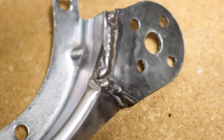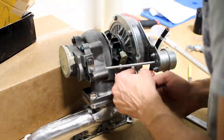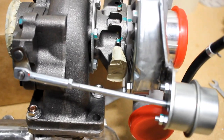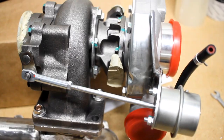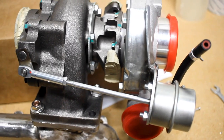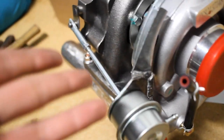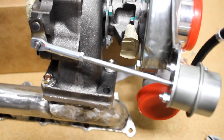All right, I got it all welded up. Now it's time to bolt it on and see if anything warped — let's hope it didn't warp. There we go, looks good. Nothing warped on me while I was welding it. I wasn't exactly that patient, but I did weld it up in sections and let it cool as I was welding. I hadn't used that MIG welder in a while — it's kind of crap — but it got the job done. So that is all taken care of.